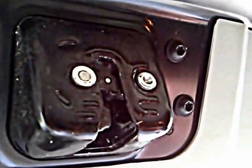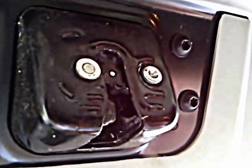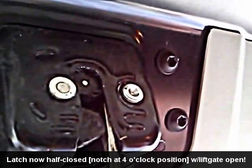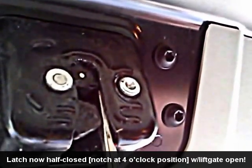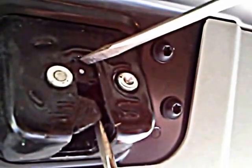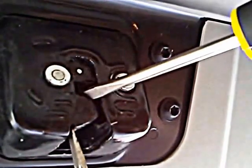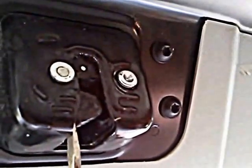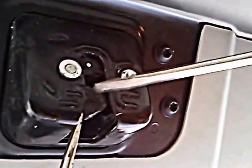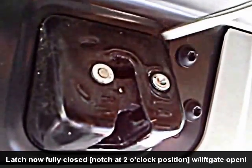What happened — the circumstances aren't important — but basically the liftgate got manually closed because there was no other good place to attach something to close it. So it was manually pushed up. You just heard it click as I pushed it with a screwdriver. As it was being pushed, there's a little spring-loaded latch and a detente in there, and that thing latched into place.